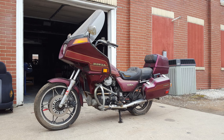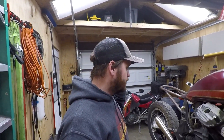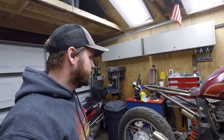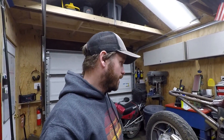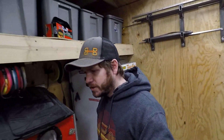I've knocked something like 150 pounds off this bike, and I've been wanting to do a GL series build. They have a mono shock from the factory — this one's off a Kawasaki or something, so we're not going to use it since it's not the correct spring rate. I wanted to start with a GL650 specifically versus a 500 because it has a dual disc front end, a larger engine, about 15 more horsepower, and a different wheel — they're just a little better across the board.